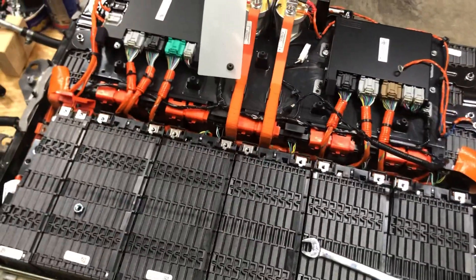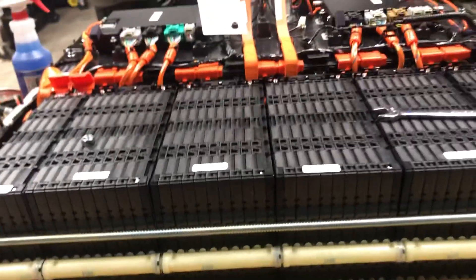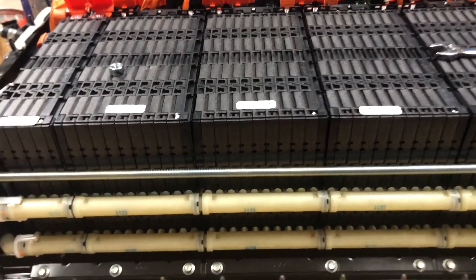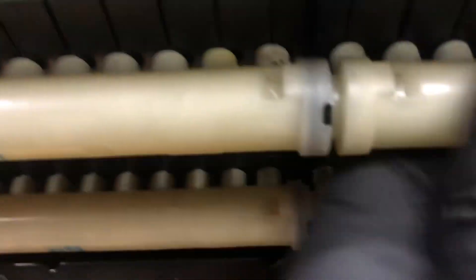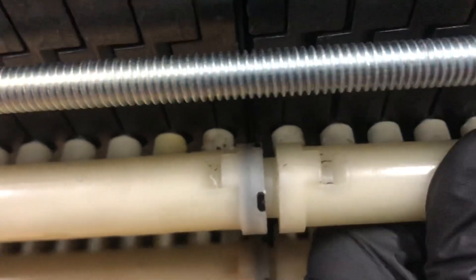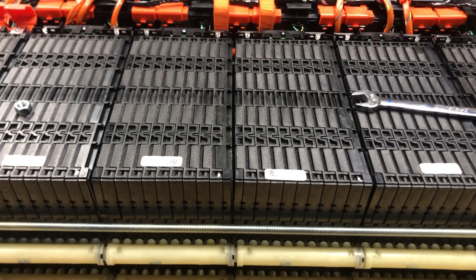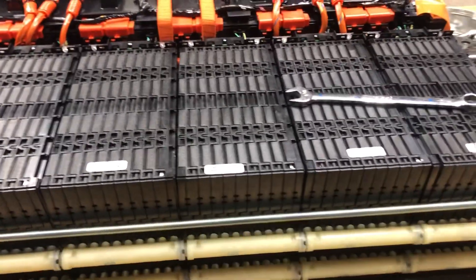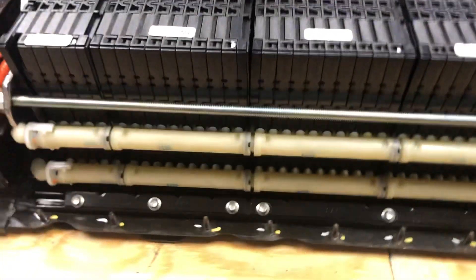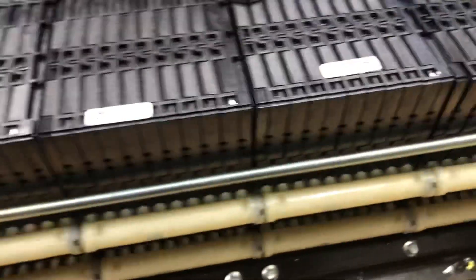Welcome back. Today we're working on the 2012 through 2017 Ford Focus battery pack. This is a culmination of the P0AA6 fault code — what happens is it leaks coolant inside the battery. These things come out, the battery starts to swell — you know how your cell phone battery, if you damage it or it gets old, it squishes out like a pillow? Well, that happens to this whole battery pack. I tried to take it apart and fix all those cells, but I took the top bracket off and realized that was not happening.